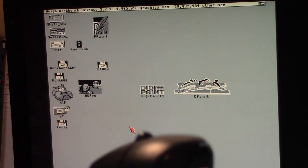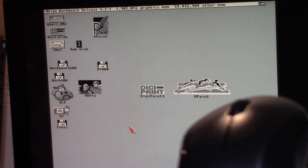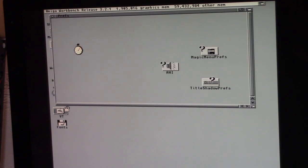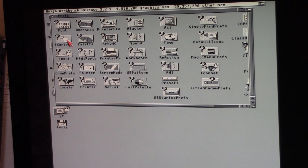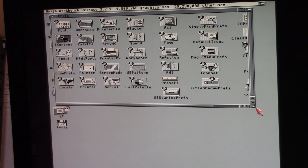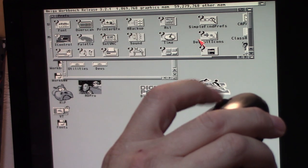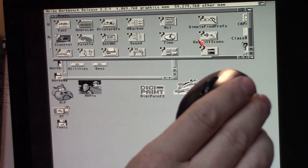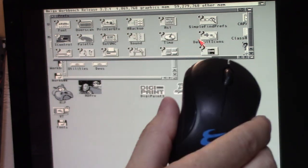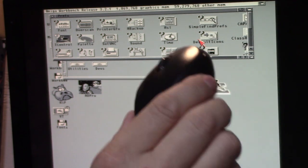Those of you who are observant will notice that the mouse here has a scroll wheel on it. And those of you who are observant will know that the Amiga with version 3.2 of the OS supports a scroll wheel. You go into iControl, scroll wheel enabled — big honking check mark right there. So, does the scroll wheel work on this USB interface? No. I can scroll all day long — I've tried it with multiple programs — the scroll wheel does not work. I've owned another USB mouse adapter created by Jens from Individual Computers, and also no luck on the scroll wheel. That's a disappointment.